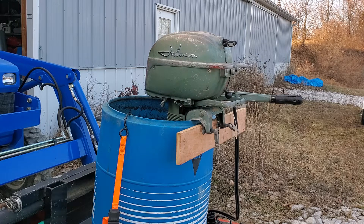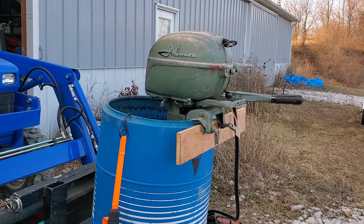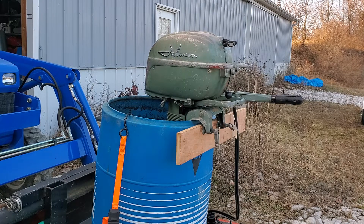I thought I'd run it and see if my new gaskets are now not leaking — hopefully they are not. I have not run this motor in over three years, so it's gonna be interesting to see what it does when I try to start it. The primer in this one's kind of weak, and these things start really well if they get a good prime, but not sure how well it'll prime. They're kind of hard to prime in the barrel because they kind of need to lean backwards. Anyway, fire it up here and see how it does.